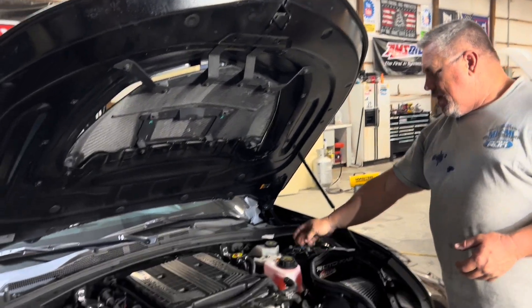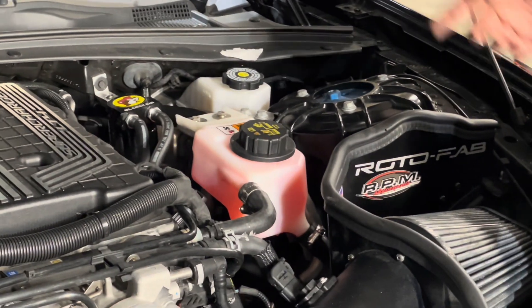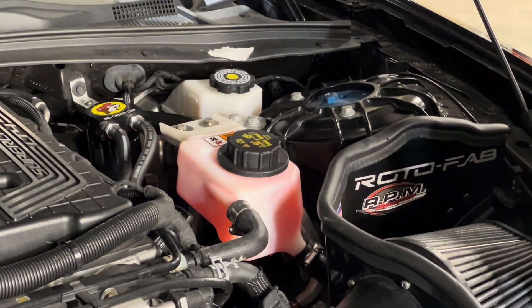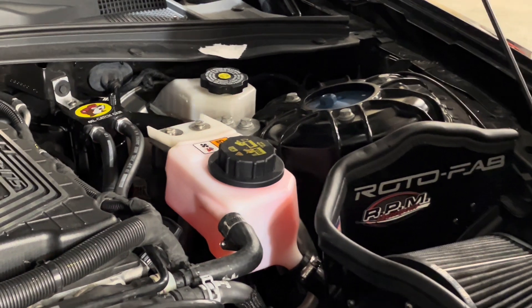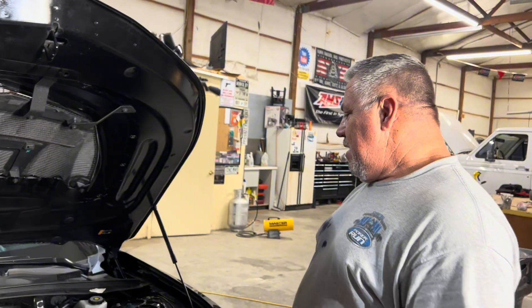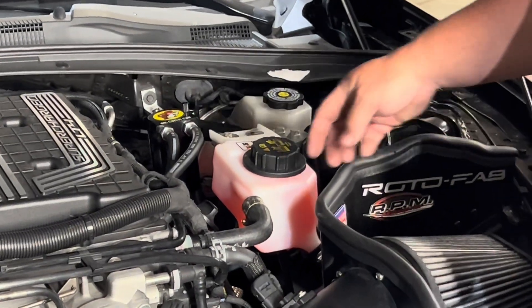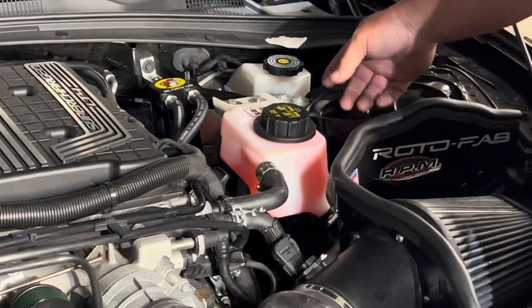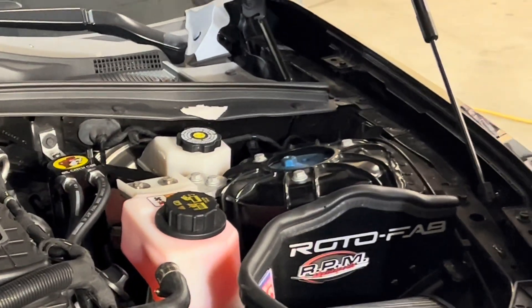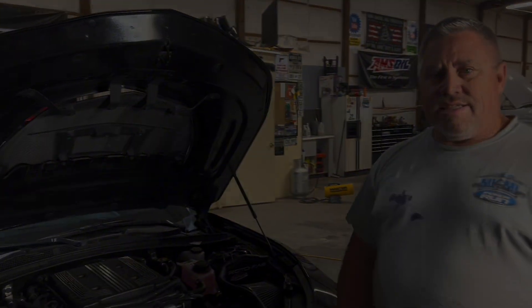I just wrapped up my new heat exchanger coolant tank for the supercharger, so now I can keep an eye on the coolant level. It adds two quarts to the system, and it's actually a 2003 Cobra Mustang supercharger coolant tank — it works out great. It's easy to install: literally two hoses and a custom bracket using existing fasteners to mount. That's what I've done lately on the Camaro. You guys have a great time, thanks for joining my channel — be sure to subscribe and hit the notification bell so you see all the next things that I do.